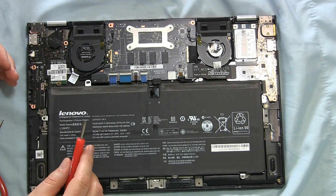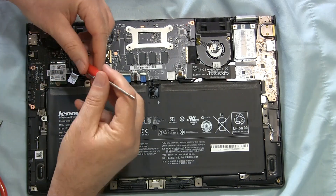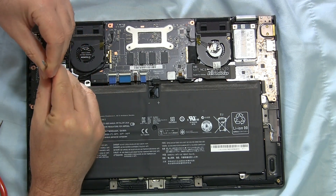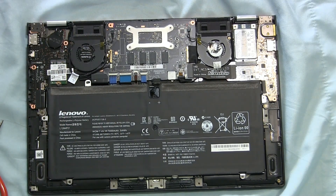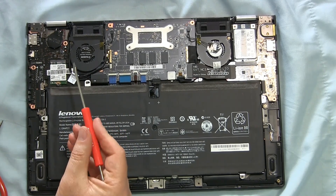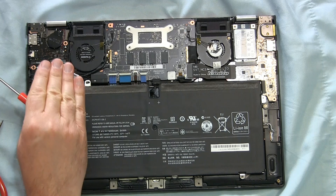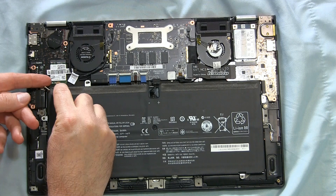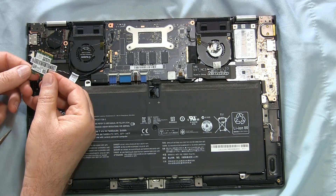With those cables pulled back out of the way, at this point you need a very small Phillips head screwdriver — not a Torx. I've got the tape; you either have to pry it up or just slice it along each edge to let the card come out. Tape is loose. I should now be able to gently lift it a little and pull it out of that slot — it's got to come up over the screw hole and then pull back gently. There's the old wireless card.